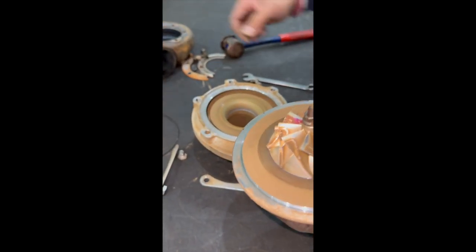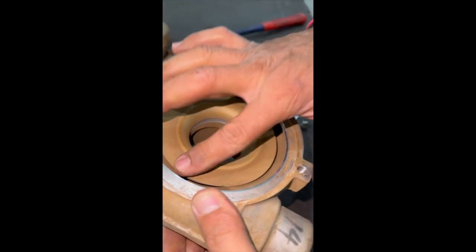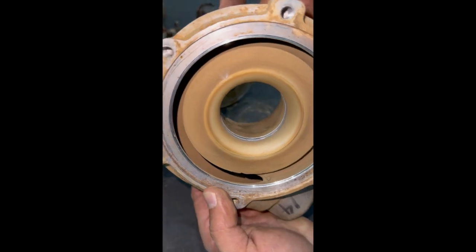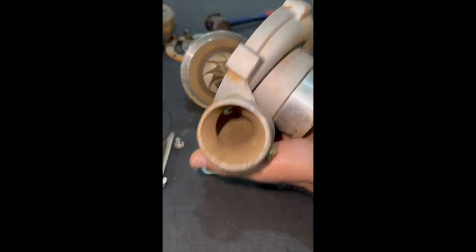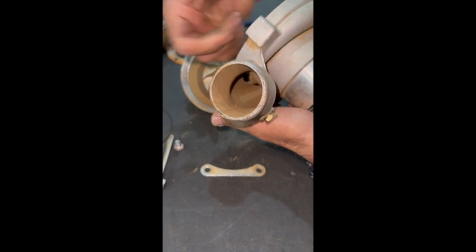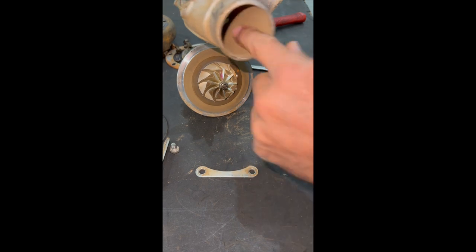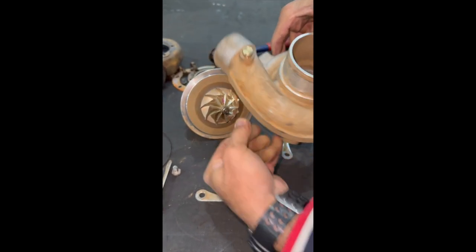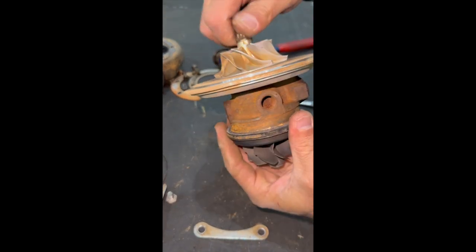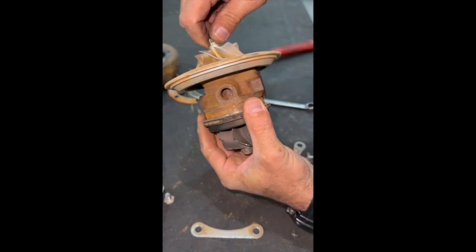Here's the O-ring, and here is what the inside of this compressor housing looks like — it's obviously very dirty. You can see the inside of the housing there; this has been running like this for a while, for quite a long time. That's obviously why you can't even get this stain out of the housing right now. There's oil leakage from behind the compressor wheel, but the sealing system is intact.